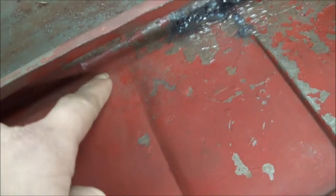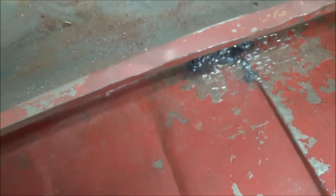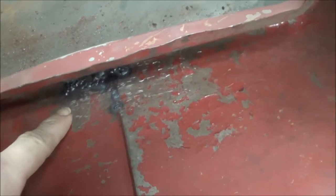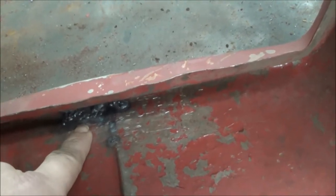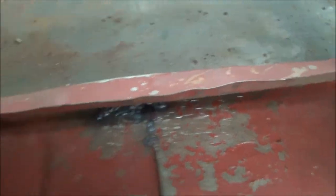There's the body line here, so I'm going to raise this area and back it up with a dolly. There's where I did some welding — I welded up that gap, and there are some marks there from where I did a little bit of raising in some places. I couldn't get a hammer down in that area there.